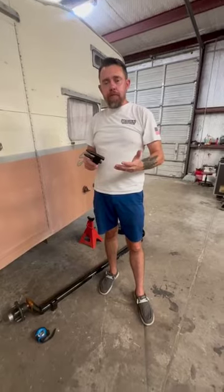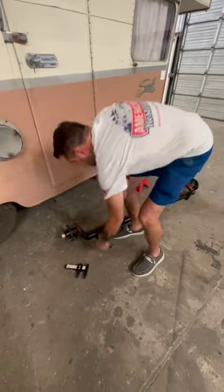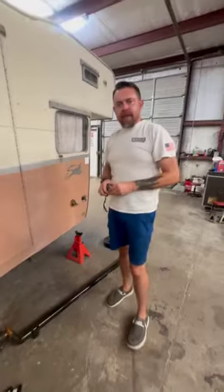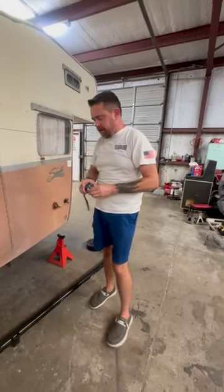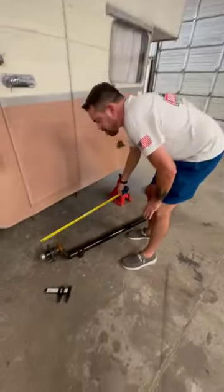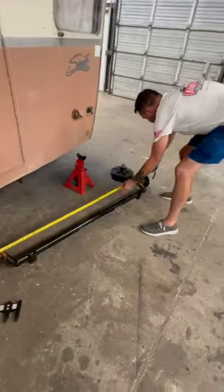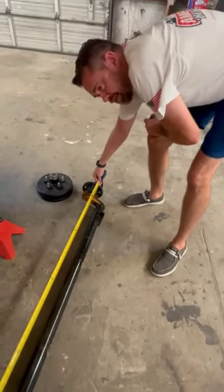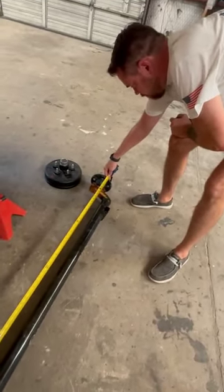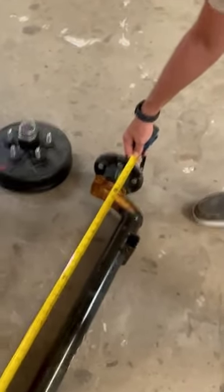And I'm going to show you a few more things. So first off we have the bolt pattern. I just showed you that. That's done. One other thing they're going to say is, what's the hub face? That's very important. That's how the wheel is going to sit on there, and I want to show you how to get that. The hub face is where the wheel actually bolts up from the hub to the hub. So where it bolts up, we have 65 on that from end to end. That's the figure they're going to ask you for. From hub face to hub face is 65.